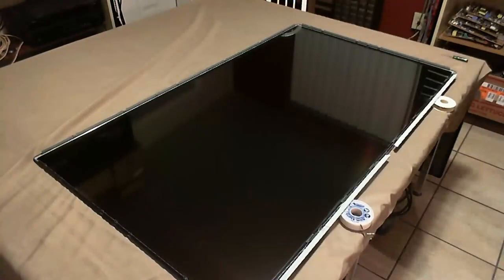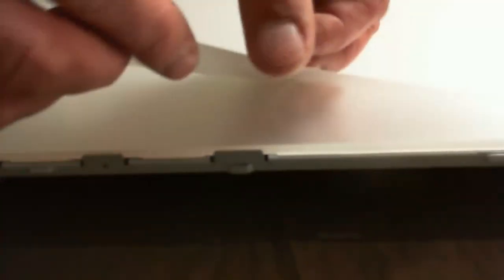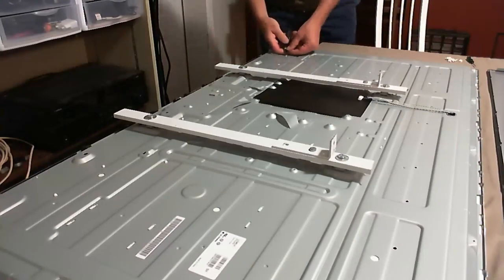This one should now not be moved. The LCD glass or the front bezel should remain in the same place. Now just remove this little plastic frame that holds all these white diffuser sheets. They are held with plastic clips. We have three thin sheets and then one big one. This bigger one is fragile so you cannot bend it too much — it will break. Remove these, and then next step remove these little standoffs and the little pins that hold the big white reflector sheet. We already see the LEDs here. This can be done from the back — removing all these little plastic pins.